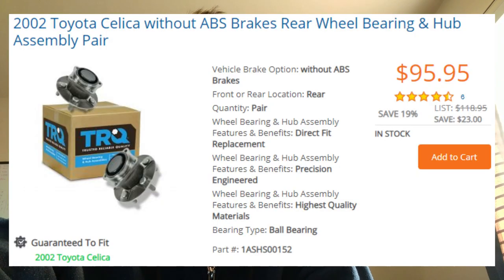In this video I'm going to show you how to do your wheel hubs. The reason I did this is my wheel bearings are bad. You can replace the bearings themselves — it's pretty cheap — but usually it's so rusted together it's almost just worth it to buy a new hub. These can be found at 1aauto.com; it was a hundred dollars for both, so I think that's a fair price and they're really well built, high quality components.